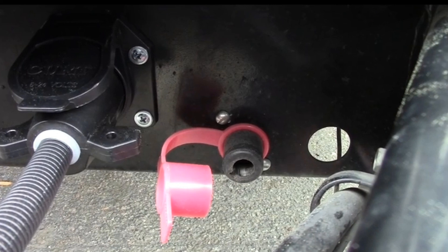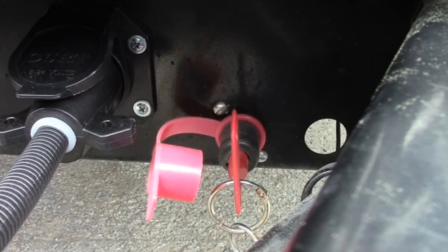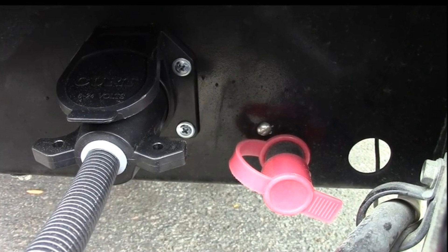You can also install a plug on your actual trailer tied into your 12-volt system, so if your vehicle is not at the trailer's location — say you're storing it — you can plug in your 12-volt connector and operate your tongue jack up and down without having the vehicle nearby. In the center is the switch for the 12-volt disconnect. You put the key in, turn the power on or off, remove your key, and cap it to keep the weather out.